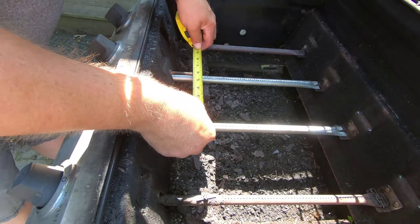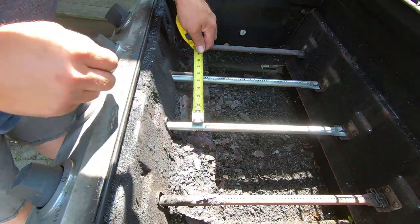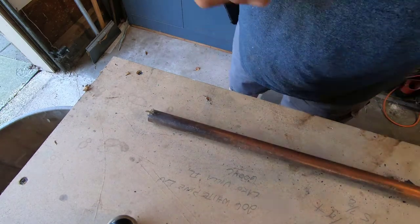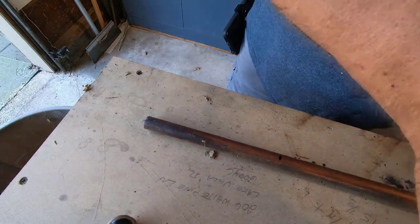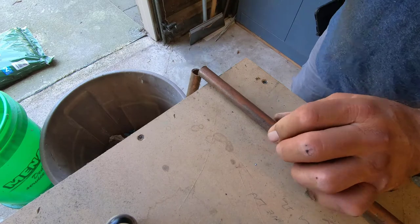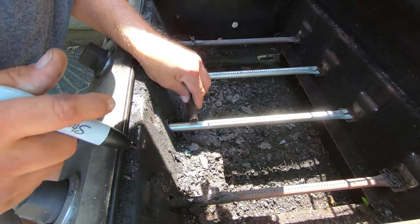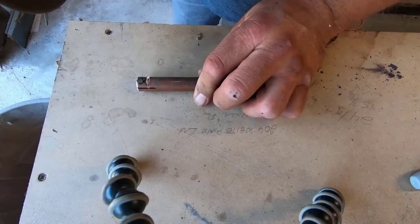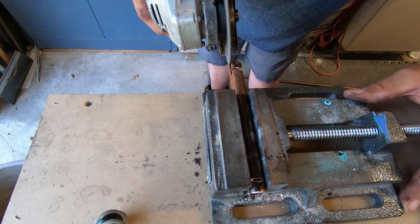Now I'm going to measure for the carry-over tubes. The carry-over tubes carry flame over to the next burner. If you don't put these back on, you'll have to light the burners manually. I measured from center to center of the burner — the measurement for my burners was 6 inches. First I'll cut these to length, then I'll cut them with my angle grinder, and clean the burrs off. The next mark I'll put on the tube is the inside edge of the burner to the inside edge of the burner. The next cut should go almost all the way through, then I'm going to cut half the tubing out and make a notch.